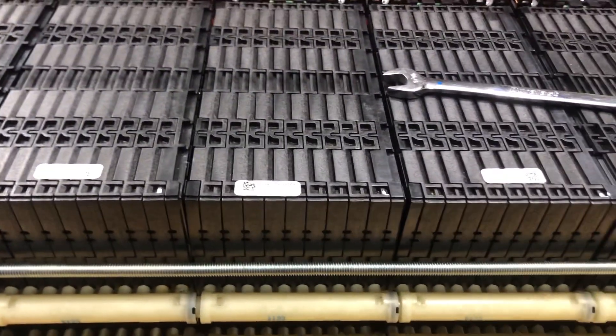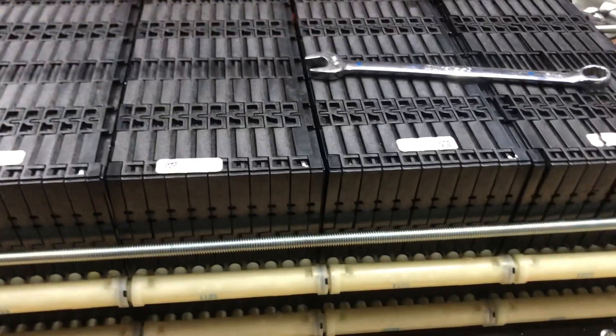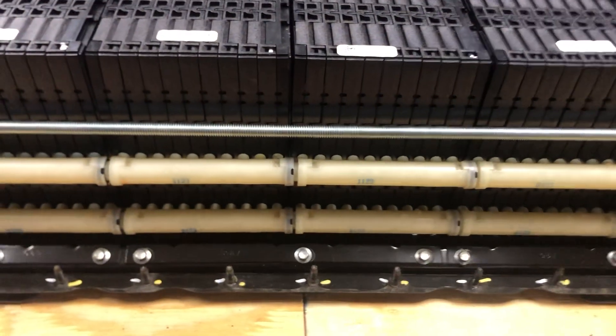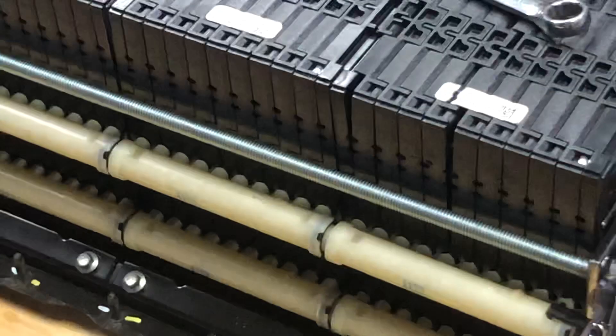Once you take the top strap off, the pack just wants to expand even more. So what I've devised is a strapping method. There's some 5/16-inch iron steel, and I had to adjust it to fit around the edge. These are painted black to kind of match the interior of the battery compartment. All I'm doing is cranking this guy back down, just squishing it back together. You can literally just watch me bring this back — not to complete spec, but good enough that it'll go back together and function.